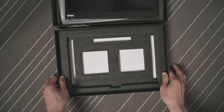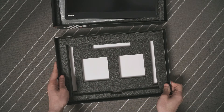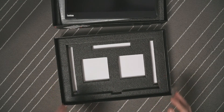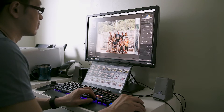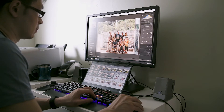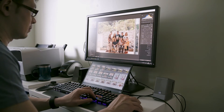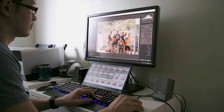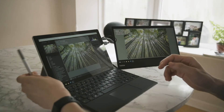In the next couple of clips I'm going to be showing you various scenarios of how I use the monitor. In this example I've connected the Type-C monitor to my desktop PC by using a special PCIe card that offers Type-C alternate mode display. The way it works is I have to connect a DisplayPort output from my GTX 1070 to the DisplayPort input on the PCIe card. That card is very difficult to track down and I've linked it down below.